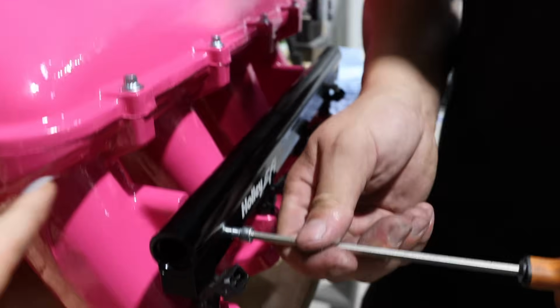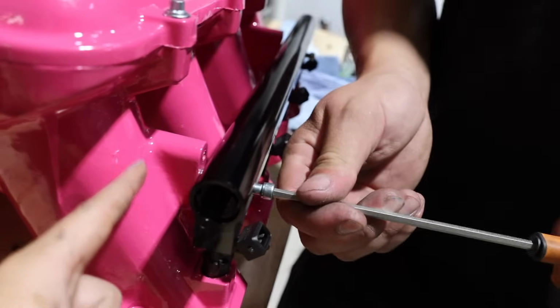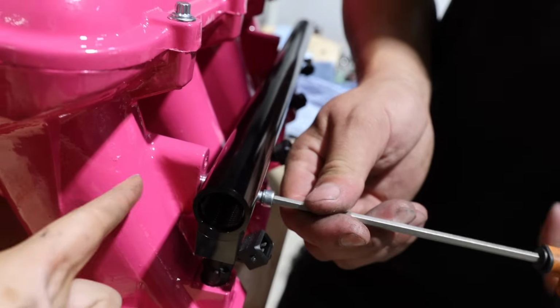Anyways, so the fuel rails were not lining up with where they needed to go on the intake, because these injectors are not long enough or not short enough. They're in between. Yeah, so the hole was somewhere in the middle. So you just drilled and tapped it. Yeah, except I didn't go deep enough. Sorry, my life. Wow.